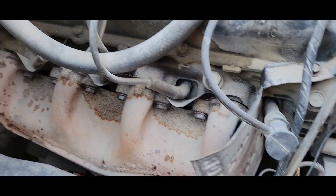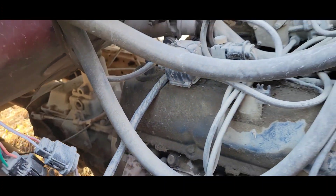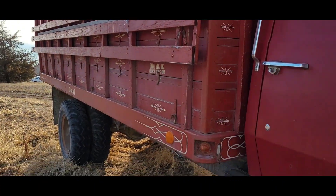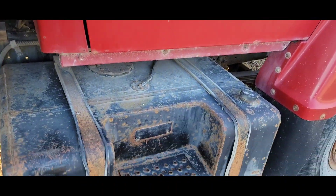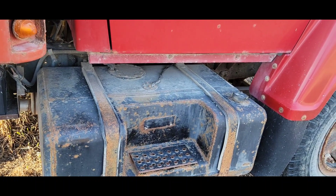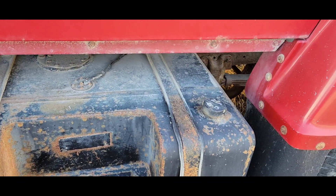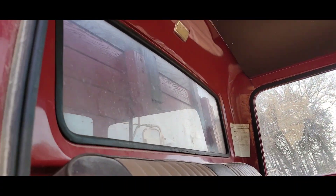This is a Clark five-speed — I doubt it's an overdrive, apparently some of them did and some didn't. It's just a farm truck, I think it's been on the farm since 1980. It's got a giant Brand flatbed — those are made in Council Bluffs, just across the river. Kind of unusual having dual tanks. He said this tank hasn't been used in years and it looks pretty rusty inside, but I'd like to get it cleaned out and tumble it with some rocks to get it working. Starting fluid — not bad.